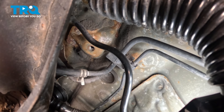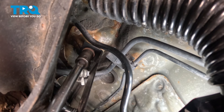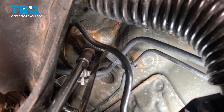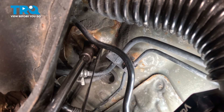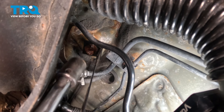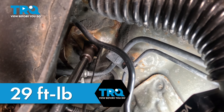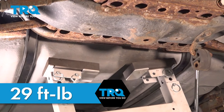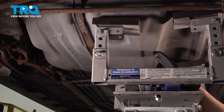Install the bolt into the strap — I'm going to be using two long extensions. Then wrap the strap around the tank, push it up towards the mounting hole, and get the bolts started. Do the same thing on the other side. Torque the tank strap bolts to 29 foot-pounds. Remove the jack from under the gas tank.